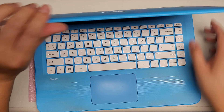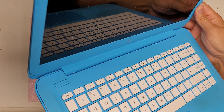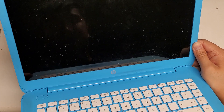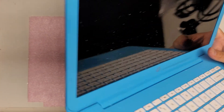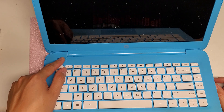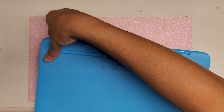We'll lift the screen up. Let's power it on and see if it does anything. The power light's on but the screen is still dead — nothing's happening. So I'm going to have to power it off and check the screen cable. Hopefully that's the issue. I did see the screen flicker off, so we will see.